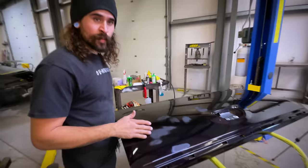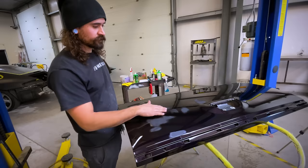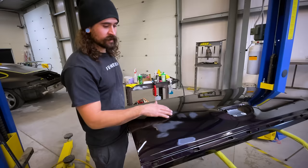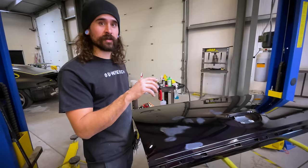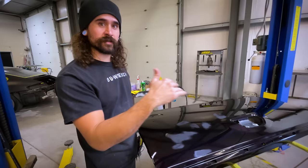Depending on what you're doing with your project, you may or may not sand down nibs and get it all super perfect. On this one I went ahead and got them all knocked down and smoothed out. You can actually use that carbide tool and the flat block on little runs and sags as well — works the same way. Just use the nib file to chisel down the majority of it, finish it off with a little sanding block, and then we're going to polish it out with the paper and get everything buzzed down and smoothed out.